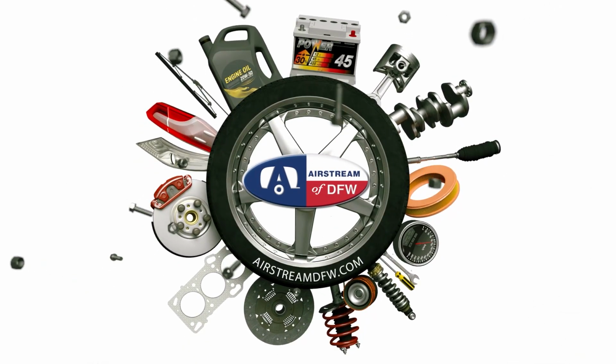So in the driver compartment, the first thing we'll talk about is your European style parking brake. European style means you can pull it up to engage it and then push it down out of the way to allow the seat to swivel. One thing to note about the seat swiveling is you want to go one direction and then back. Do not ever rotate it around 360 degrees. The wiring for the airbag in the seat will get stretched and pulled, and you'll have to take it to Mercedes to have that reset. So you can rotate it one direction and then back. Back to the position and disengage it just like a standard parking brake.